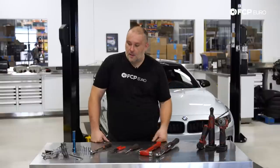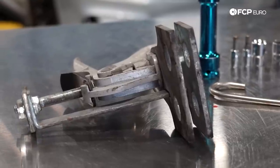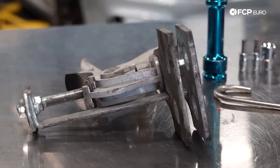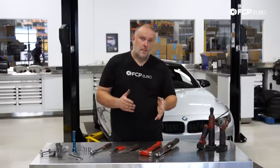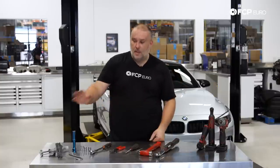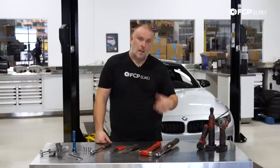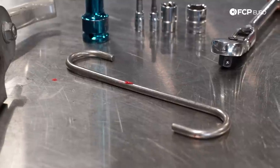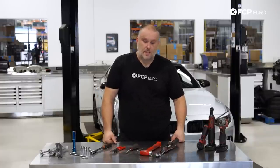If you have power tools, this will make it a lot easier. Two requirements: you will need a caliper depressor of this style to push in the pistons all at the same time. If you push one side in without the other, it's just going to move the pistons out on the other side. So you need to push them both in at the same time — that tool is a requirement for cars with these types of calipers. And of course, some kind of hook like this to hold the brake caliper up while you're servicing other parts of the brake system.